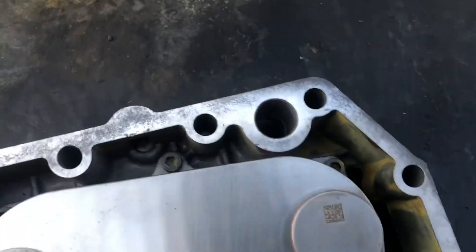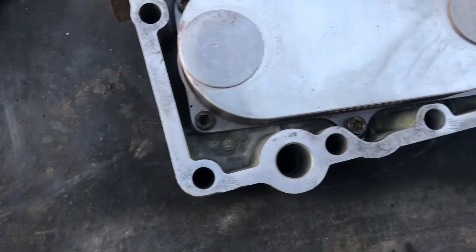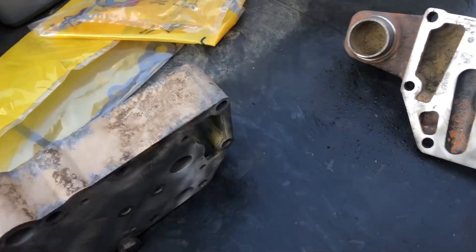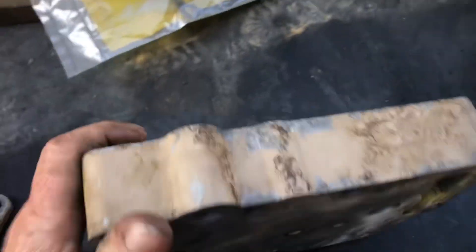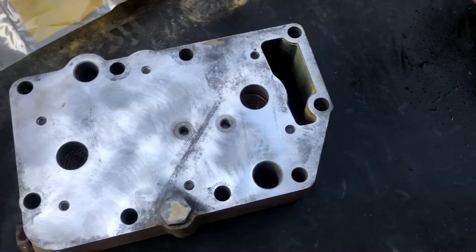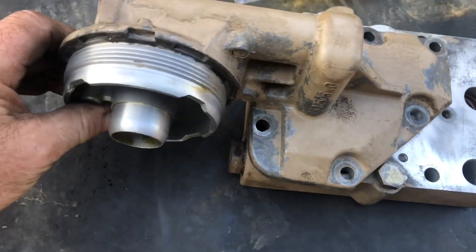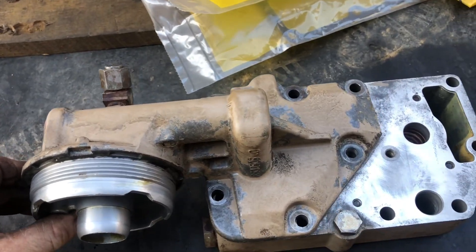Here is the old oil cooler and here is the new oil cooler mounted in the housing. It's got six little allen head bolts, all metric of course. This goes right up against the block of the engine, and then your oil filter housing stand goes on there and bolts to it also.